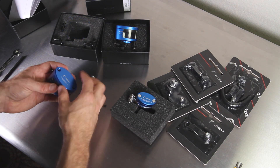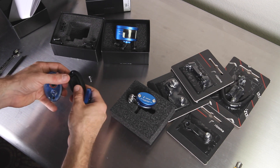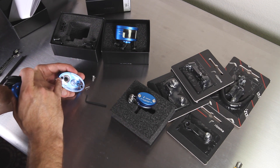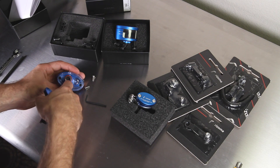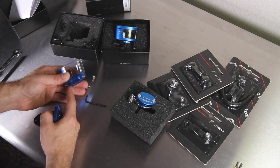You pop the top off of the CT-127 with an allen key to reveal a diaphragm. If you look closely, the bolt holes are not sealed. It's important that you do not get fluid in these channels while filling. At the bottom of the tank you have a sturdy o-ring that seals the unit — you aren't going to have any leaks from this area.